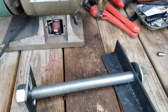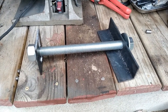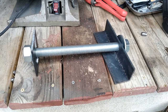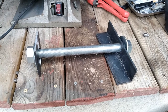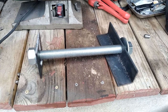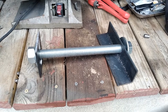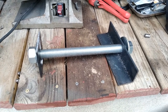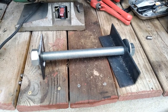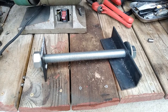I'll be filming tomorrow, trying to get these sleeves out. I don't know how much I'll get done — if I can get the sleeves out and get the cylinders cleaned out, maybe put the sleeves in tomorrow. I'll have to dry fit them, drop the sleeves down in there, and see how far up the lip sticks over the top of the block. Should be no more than about five thousandths, I think is what they call for. Hopefully they're close to perfect and they're not below the deck — that kind of head gasket seals them up there, and if it's below the deck it doesn't allow the proper crush on the fire ring. The fire ring's on the head gasket there.